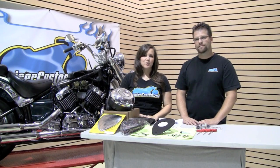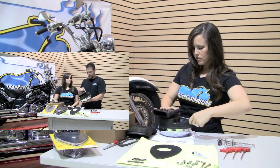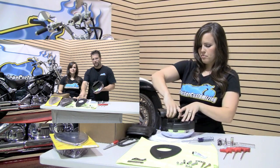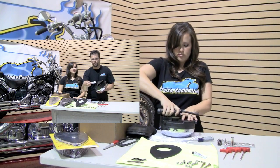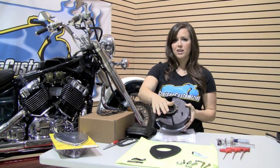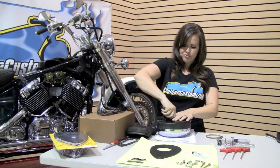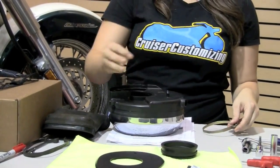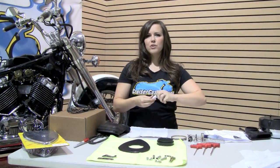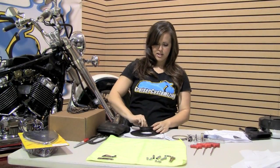While fuel management is the most important part, the actual installation of the air kit is pretty simple. We're going to start this installation by removing the factory inlet and applying it to the backing plate using some rubber cement. Now we're going to transfer this rubber boot from our air box to our new backing plate, running a bead of rubber cement right along the smaller inside edge, and setting it into place.